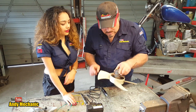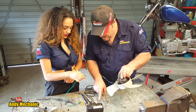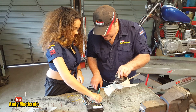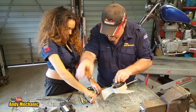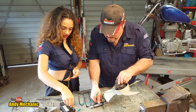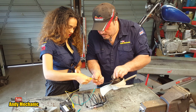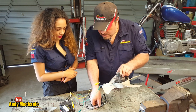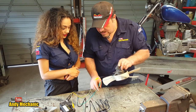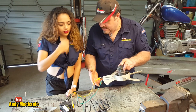The next job is to get the motor. We just need to connect the test light to one of the leads — put your jumper lead onto the motor lead and then down onto the test light. Now, obviously, we've got a circuit going on, we've got current flow, and you can see the bulb is lit in the test light. It's a complete circuit. The current is being restricted by that bulb — basically it's acting as a resistor. That's why the motor is not actually spinning up and turning.